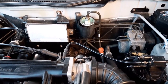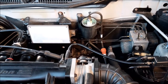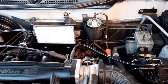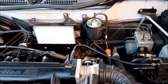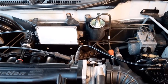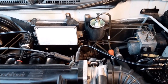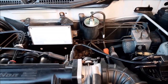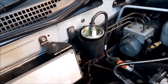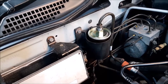Once you've got it all tight and you're happy with it, you need to check it's not going to leak. We did have it leak once and had to undo and redo it, and then it sealed itself — that problem is normally easy to resolve. Because it's an electric pump, all you need to do is put the ignition on; the pressure will build and you can see if there are any obvious leaks. Once you can't see any leaks, you can go ahead and start the car. We've put the ignition on, the pump comes on and builds pressure, and there are no leaks.